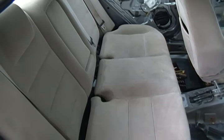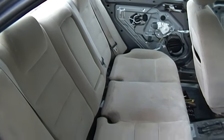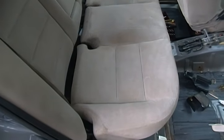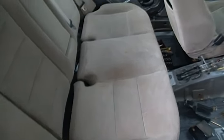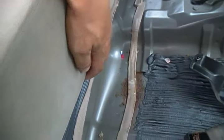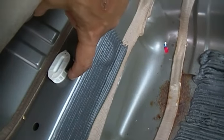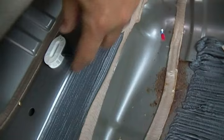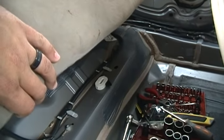It's October the second and we're going to remove the rear seat from the car — actually an incredibly simple process if you've never done it. When the seat is mounted, you just lift up a little. There are these little plastic pieces; you simply pull toward the driver's side and lift up, and this side will click out. Then you do the same thing on the other side — very simple.